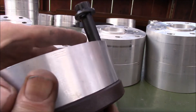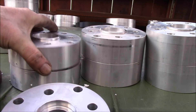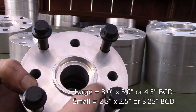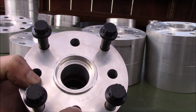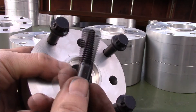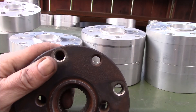I've got to get a couple of these packed up — we've had customers waiting several weeks. These are typically used on more like passenger cars that use a two and a half inch bolt center. Let us know if you need metric, which is M12 by 1.75 coarse thread.